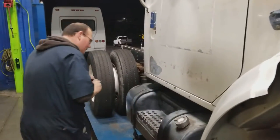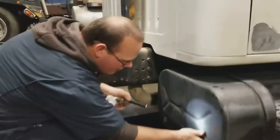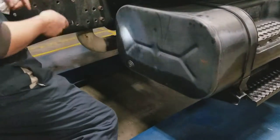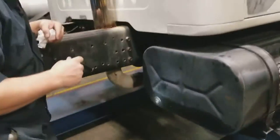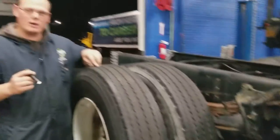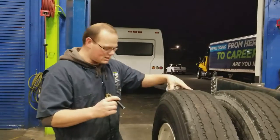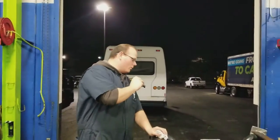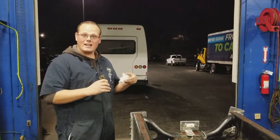We're going to check our gas tank. If you look here, it looks like there's a leak — there's discoloration. Now, is this from the gas tank or is it from water spilling? That's what the inspection is for — it's like starting an investigation on the truck. I've got a tread depth gauge on me so I'm going to check the tread depth. These are disc brakes, so the brakes are inside behind a shield. There's a little window where we can check our pads — they don't look used a lot, not new but not heavily worn either. Also, if the truck is working, make sure you check the brake lights, reverse lights, and alarms — all that is DOT stuff.